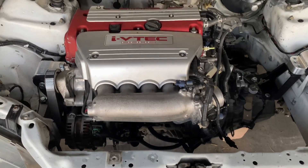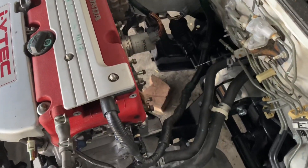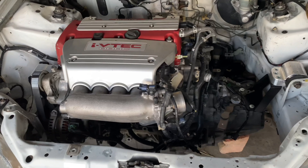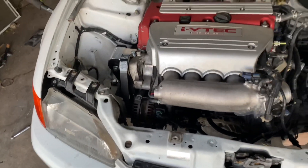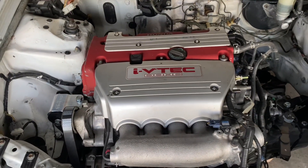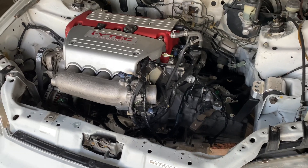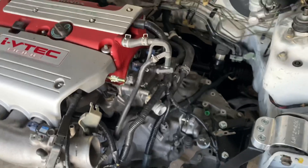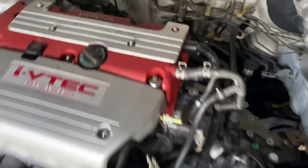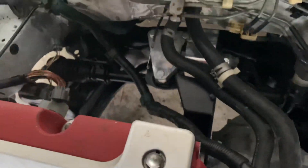Tomorrow we're going to be installing the K-Tune fuel system, putting on our K-Tune headers, and installing the half shaft with base model axles — which are 32 millimeter. The reason is that 36 millimeter axles are the Type S ones and won't work unless you have adapter hubs or a five-lug Type R setup. We'll also be installing the radiator and most likely doing the wiring so we can get the car to start — I want to try to get it started this weekend. We'll go over the speed sensor wiring, starter wiring, and the alternator charge harness. I also did the hoses real fast and they seem to fit pretty good stock, but I might have to cut a little bit once the headers are in.